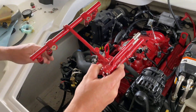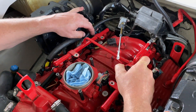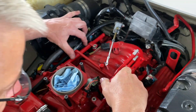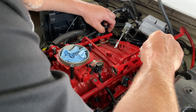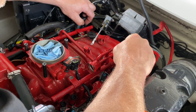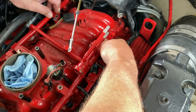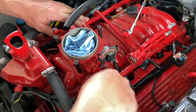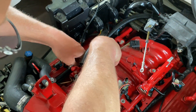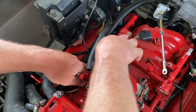We're going to install this now. Get everything out of the way and line up your ports. I took a q-tip with some motor oil and wiped around the inside of the port where the injector slides in to help it go in better. Now it's just a matter of plugging them in — snap in, snap in, line them up, snap in.